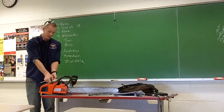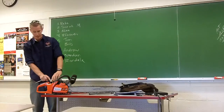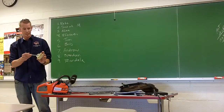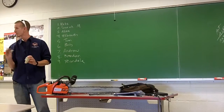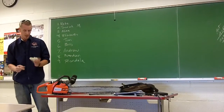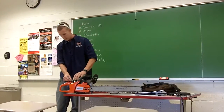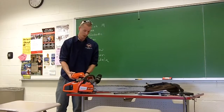Just put everything together. So you pop the top off, put it to the side, you get your air filter underneath. Comes off pretty easy. The bottom is where the actual filter itself is. To clean that, you can either use, I scrape it off a lot using the scrunch, or you can use an air gun. If you have an air gun, blow it all off. Once it's clean, just put it all back on, lock everything back down, and that gives you a nice clean air filter.